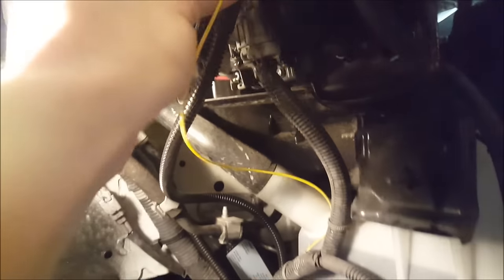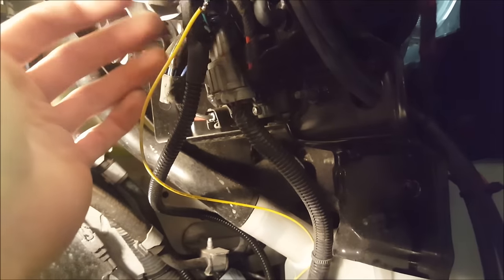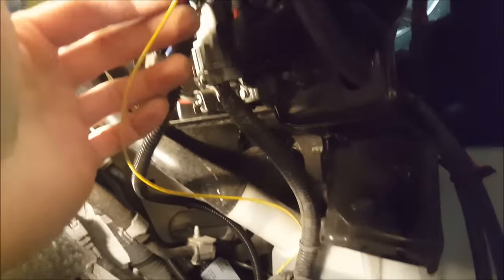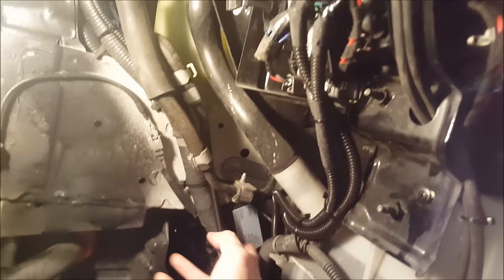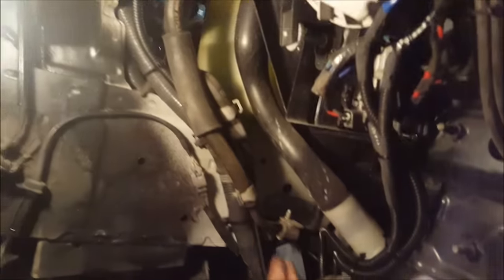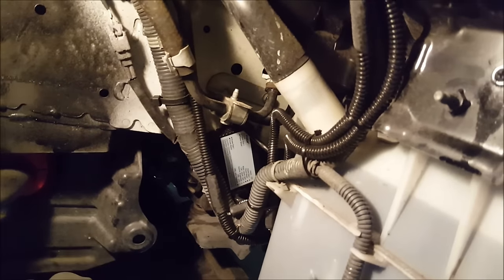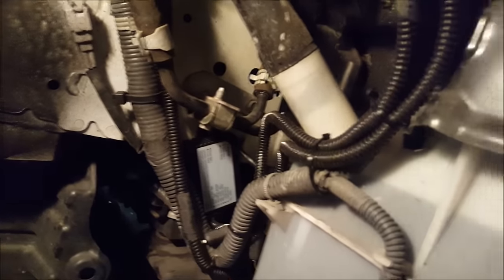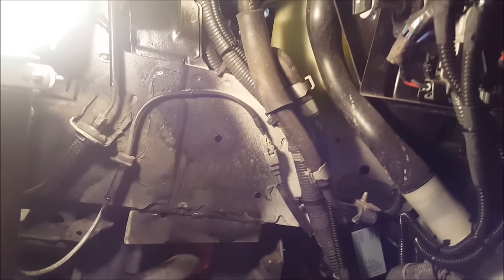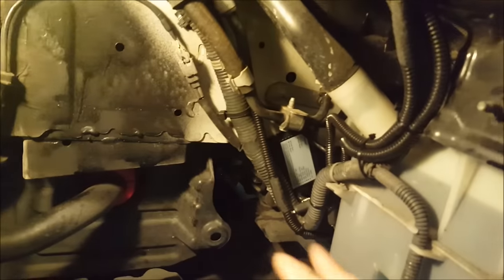We are almost done with wiring. The parking lights wire and the new white wire I added trigger the relay so it's feeding voltage. The yellow wire is for turn signal. I am all done on the right side — here is my module. There's no other place because of these power steering lines in the way for the reservoir. I mounted it to the frame using a self-tapper screw with thread lock added so it won't corrode. While I was in here, I also sprayed a little bit of undercoating on some exposed bits of metal and put dielectric grease in all the ABS and washer plugs.